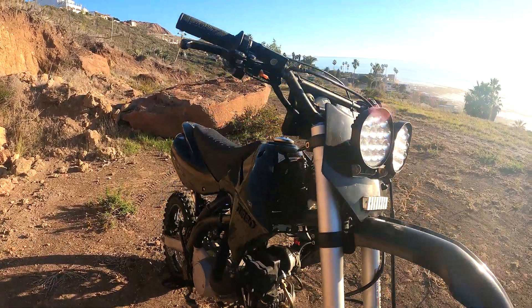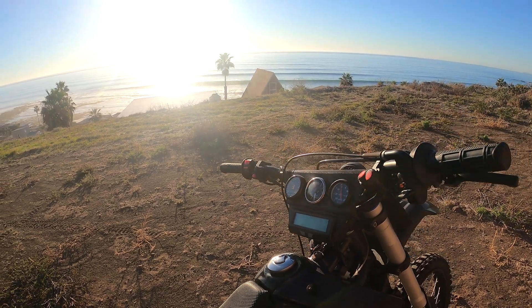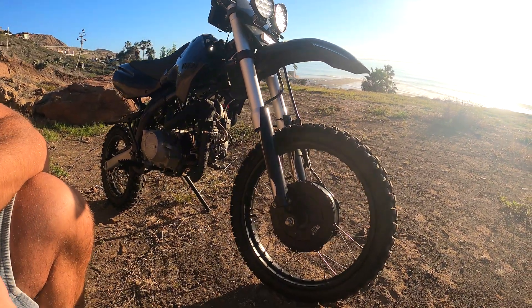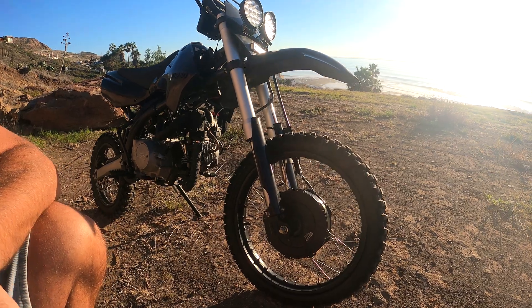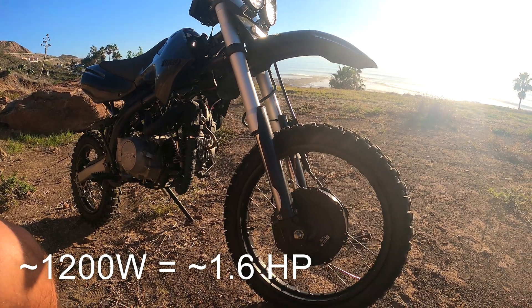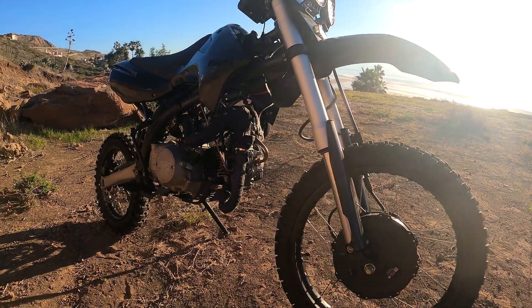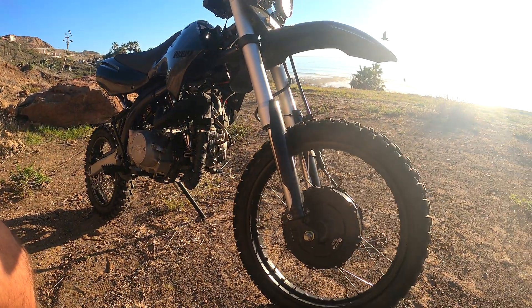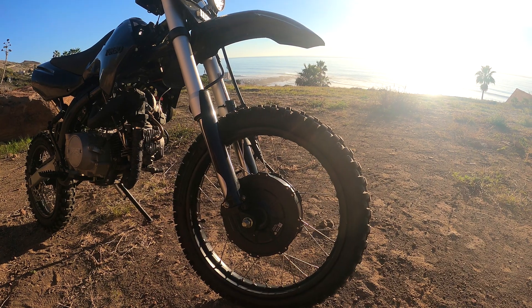The cycle analyst will keep everything from frying once it starts getting hot. This is all-wheel drive — the front-wheel drive you only use when you need it, going up a hill or something, so it's really only intermittent use, which is ideal for these kinds of motors because you can put a lot more power through them than running it continuous. This thing makes not even two horsepower, but it's an extra two horsepower — this little motor only makes eight or nine stock. Once I put in the higher amperage controller, I'm hoping to almost double that.